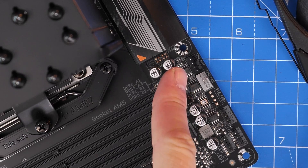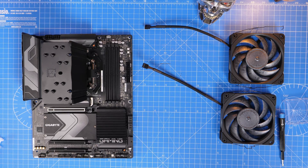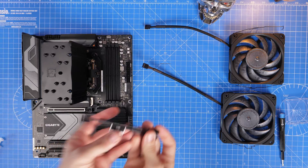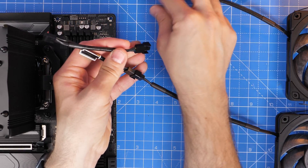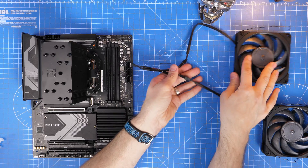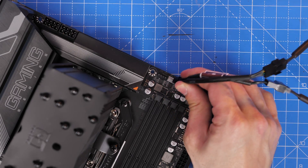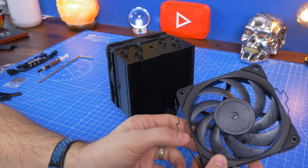Next we need to think about wiring. You need the CPU fan connector on the top right of your motherboard. The fans have one cable coming out of each, and there is a Y splitter cable included which you can connect those cables together into a single connector to plug directly into the CPU fan header. Alternatively you could connect one fan to the CPU header and one to CPU optional. There are also low noise cables included in the box, but I wouldn't recommend using them — in my experience this cooler is surprisingly quiet even with the standard cabling.